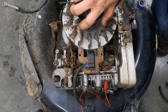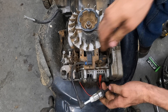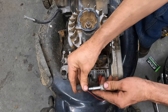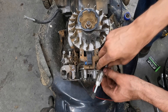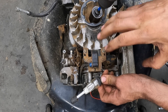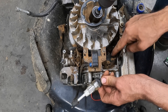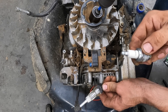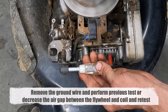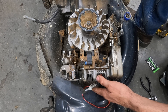Grab the card and rotate it out. Make sure there is no rubbing of the flywheel, and we're ready to retest. Hook the spark plug tester back up — I'm still leaving the spark plug out, that's the safest way. Route the wire back through the way it was. I still have the bail handle squeezed on the handlebar, leaving the brake off. Now that the ground wire is hooked back up, it's disconnecting this ground wire just like it would when you're trying to start the machine, but the spark plug is removed so it won't start. There you go — we now have spark!